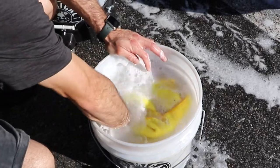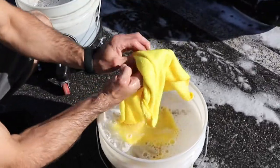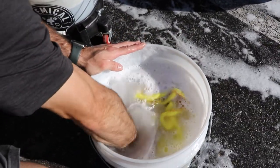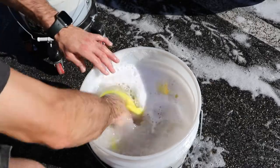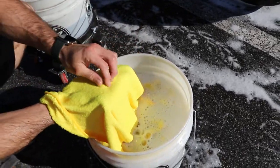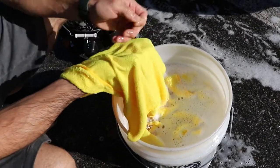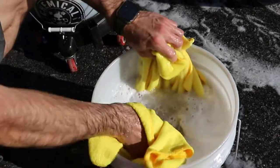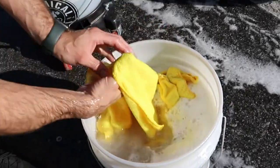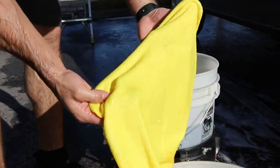So during the wash, you can see I picked up some dirt and debris from one of the crevices. You're going to want to use that two bucket method to just break all that free. What's good about the wash mitt is you can open it up and rub it on the grit guard at the bottom. Flip it over, rub each side — especially the side that has the dirt. Push it down, you can see it floating. Just to loosen it off, because you don't want to keep dragging that around the car, especially if you have a newer vehicle. You can see it all came off, just a couple pieces left.